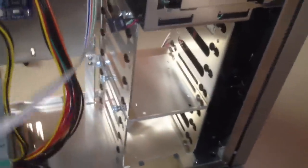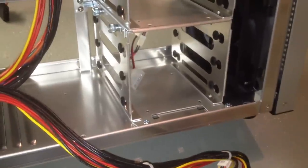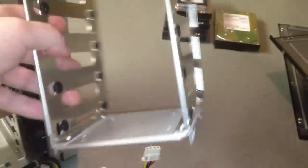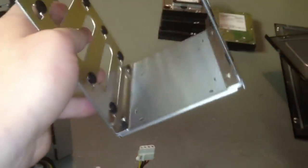And the next step is to put the hard drives in. Lian Li has improved upon their design with the K7B very much with this one. What they've done is they've actually made parts of the hard drive cages detachable with thumb screws like this. I need to take the whole entire cage out, so I'm gonna get a screwdriver in here and loosen them a little bit. You can just unscrew all these, take the cage straight out, and stick your hard drives in. How awesome is that? I love that — bravo, Lian Li, bravo.